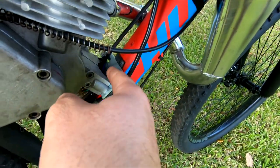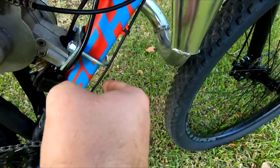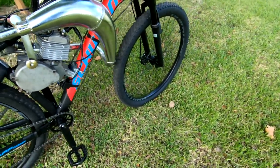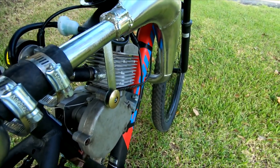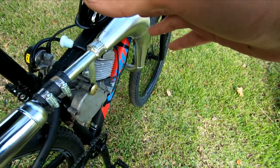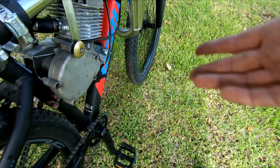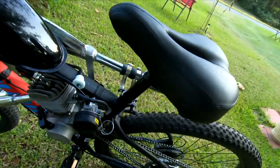There's not really a lot of down forces on the frame, so this contact point is fine. Most of the force the frame will experience is at the U-bolt as the motor pulls back on the chain — that's the more important mounting point for motor stability and chain alignment. The intake is the CNC BBR tuning from BikeBerry. I really like this intake — it is beautifully made. It's designed for a 40mm cylinder, so it's not a universal 30-to-40, which means your intake can actually be matched to the cylinder. You want the 40mm mounts for better flow. It even comes with an O-ring, though we're using rubber hose anyway.